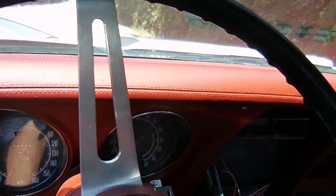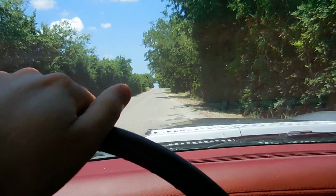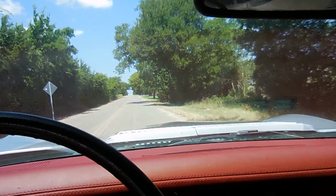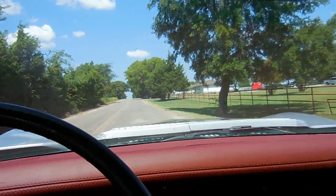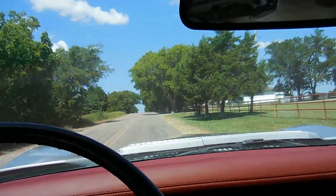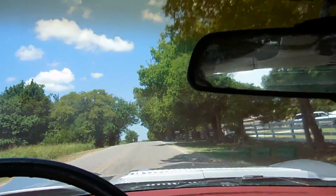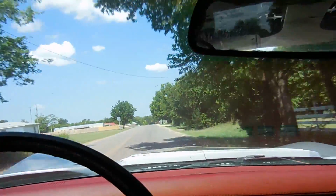Still recording. Look at this, guys. My tripod broke. That's kind of sad. Alright, guess I'll hold it. So there's a noise coming from the rear end, and I think since I put that new leaf spring in, that is the exhaust touching the leaf spring. You can hear it's kind of a rattle. Thought I was going to get away with a cheap fix, so now it's either go back to that fiberglass spring, which was expensive, or put a different exhaust on it. I'm thinking maybe a different exhaust, I don't know.